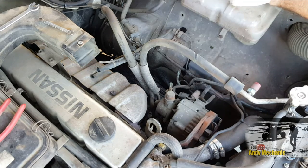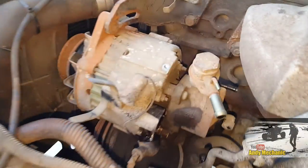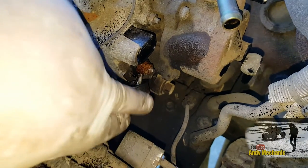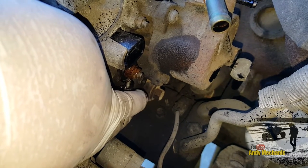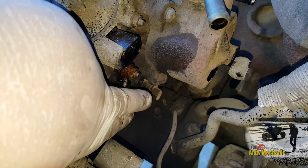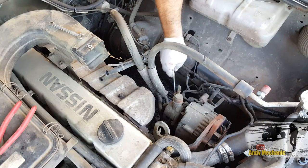We've still got the B plus post. I'm going to spray some penetrating oil on there while we undo the last bolt. Just to give you a quick close-up before I pull it all apart: that's all the vacuum pipes out of the way, we've undone the plug, we've undone the earth. All we've got left is the main output and you can see it's a bit rusty in there. Just down there is the pivot bolt — that's the last bolt holding this alternator in place. So I'm going to slacken that off, move the alternator, get rid of the belt, and we should be able to lift the alternator away.